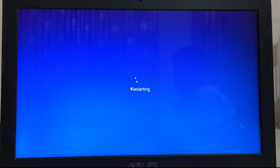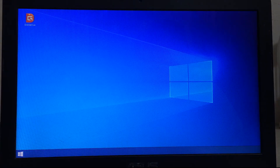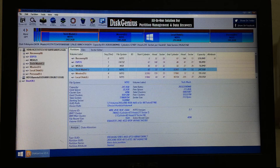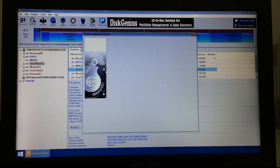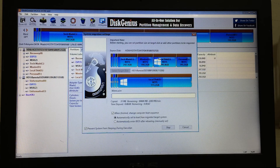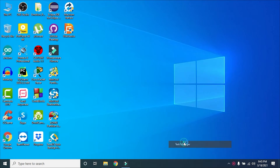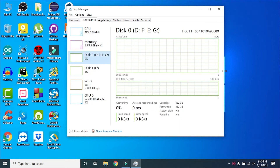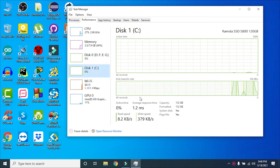After the restart, your computer will do everything automatically — you don't need to do anything. DiskGenius will open and do its job. You can also use other software if you find a free one or want to pay for one. The software shows an estimated time remaining. I'll skip ahead since you don't need to do anything during this process. Once done, right-click, go to Task Manager, and under Performance you can see we now have two disks — Disk 0 is our hard disk and Disk 1 is our SSD, showing 112 GB capacity.